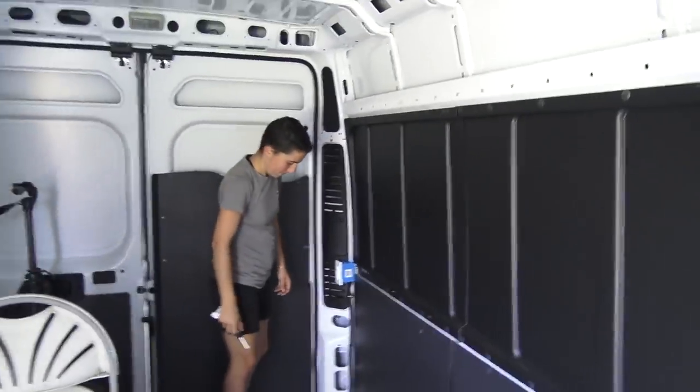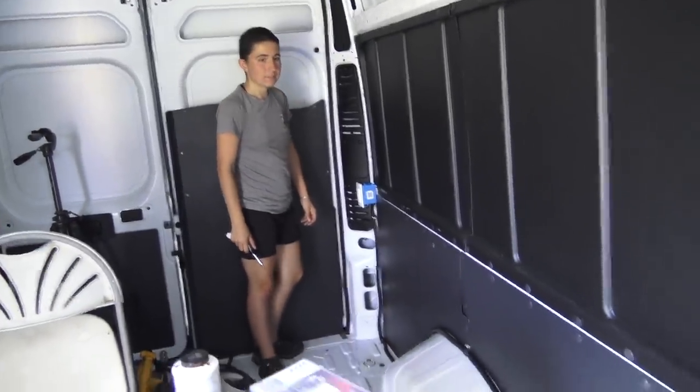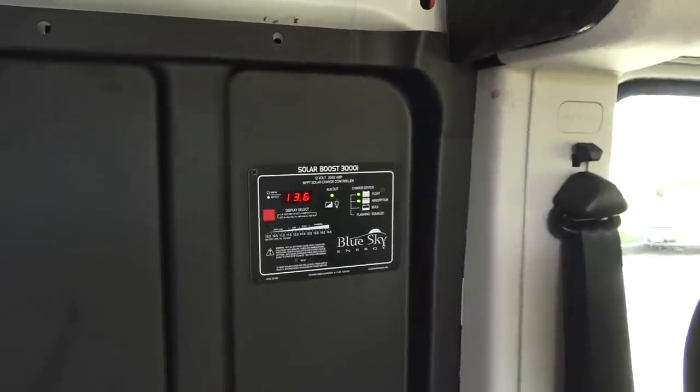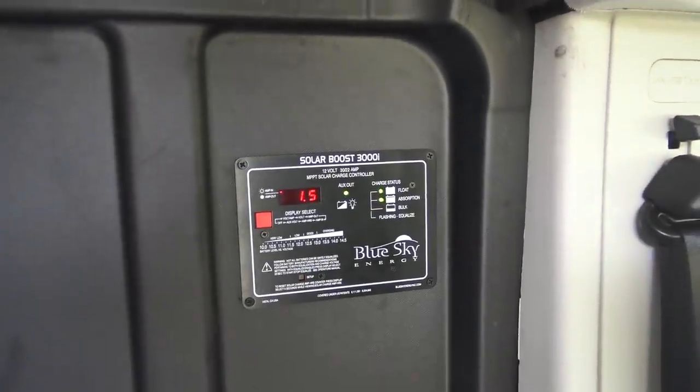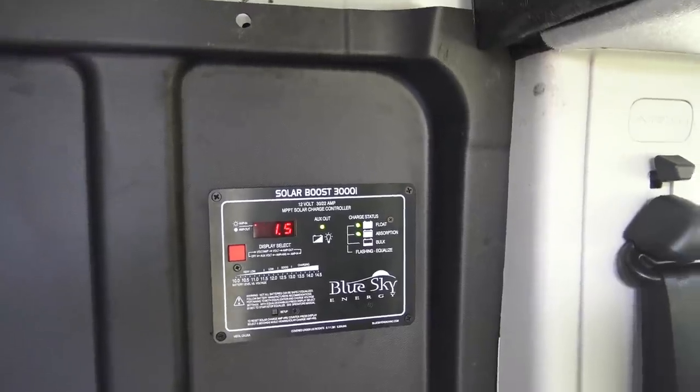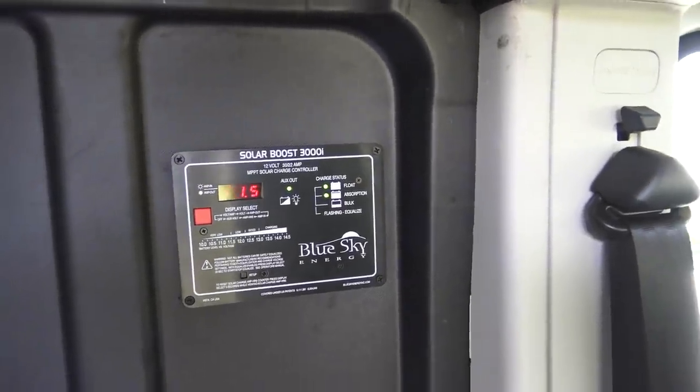Okay, you all done with that last wall plate? So we have one here, here, here, and one right here. These are 15 amp. We are on auto. The inverter's on. Our service charge is 13.7. The reason that we're only pulling in 1.5 amps is we intentionally parked in the shade so we could work in the shade. Let's test it.